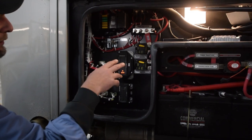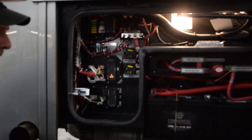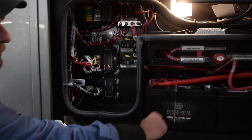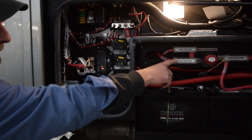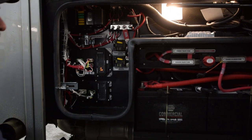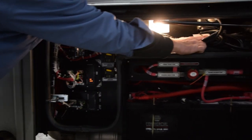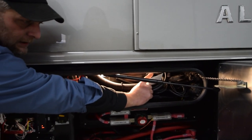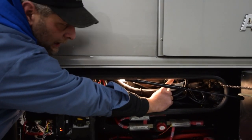There are multiple other fuses and test points for service items only. Going over here, these are your chassis engine start batteries with a disconnect, and all your main mega fuses are labeled. Also up in here, there is a plug for your block heater, to be used in cold locations to warm up the engine before you start.